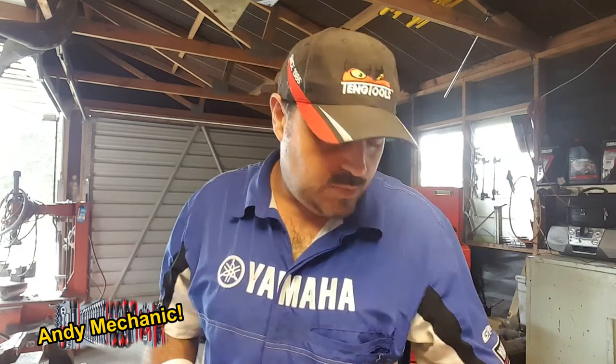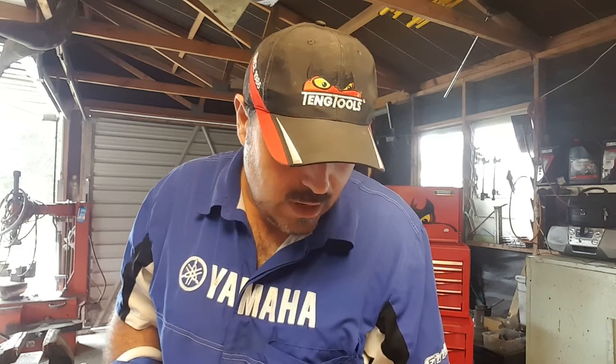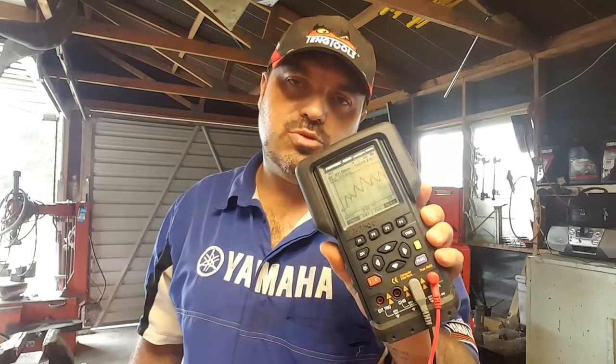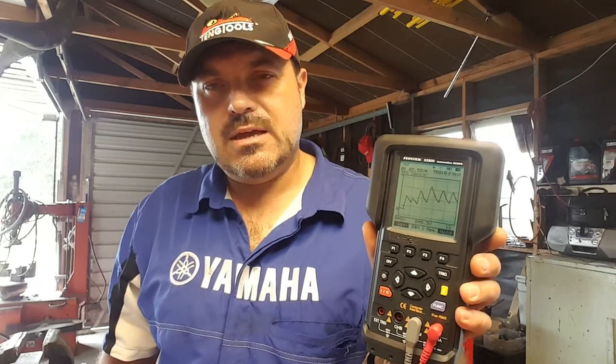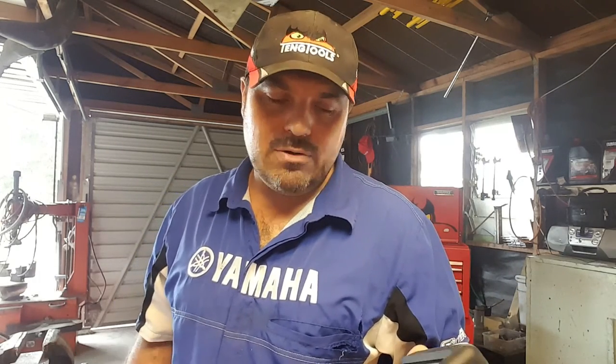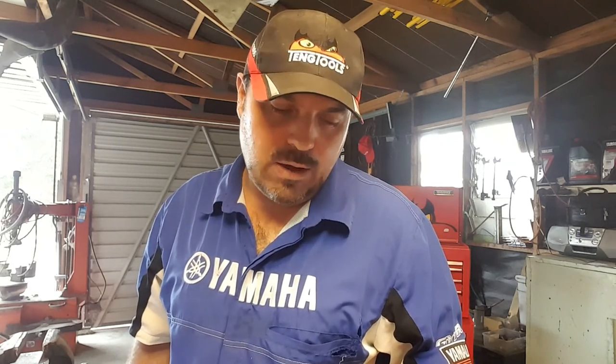Okay, so far, and I'm trying to do this reasonably quickly for you, and I'm sure there'll be lots of bits and pieces I need to edit out, but we've seen the limitations of a voltmeter in comparison to all the extra information we get when we use an oscilloscope to measure the same signal output. With an oscilloscope, we see history, we see a much broader image with a lot more accuracy, and we can see very slight changes in signal output and defects. If we can see a pattern there, and one of the actual parts of the signal doesn't quite look like it should, that could flag a fault code on your ECU, or at least cause the car to do something that you're not expecting it to do. Maybe the engine's not idling correctly, or it has a surge, or it has a flat spot, or whatever it is.